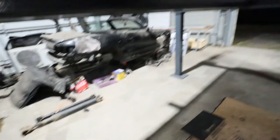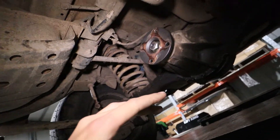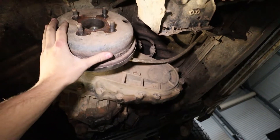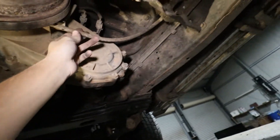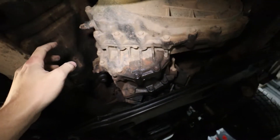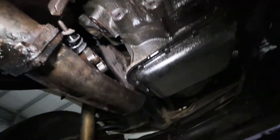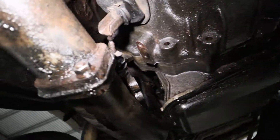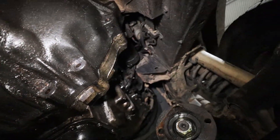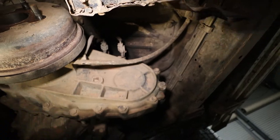Under the Patrol, we've already got our two drive shafts out — I used two spanners to crack the nuts, and a long breaker bar on the handbrake. Before we get into taking the gearbox down, disconnect the handbrake line, any cables on top, and any breathers going to the gearbox. Don't forget to disconnect your slave cylinder. The bell housing bolts along here are all 14mm, apart from the ones at the top which I think are 17mm — you'll need to reach down from the top to get those.